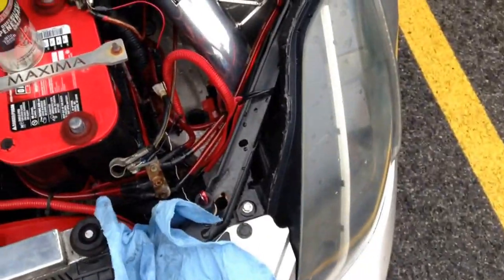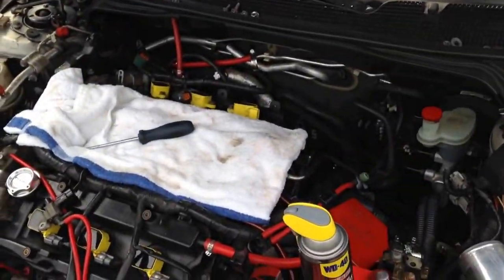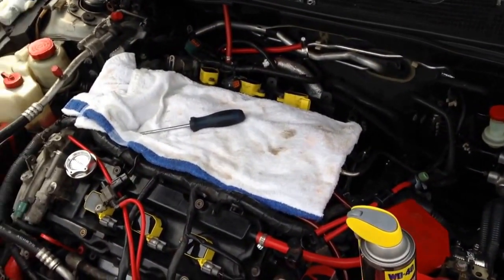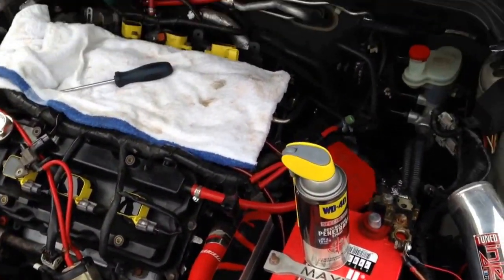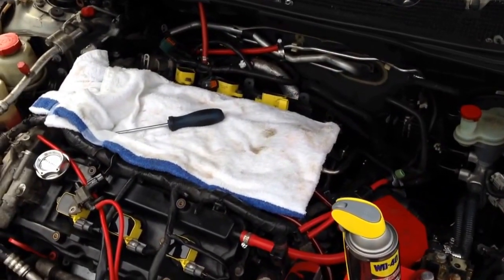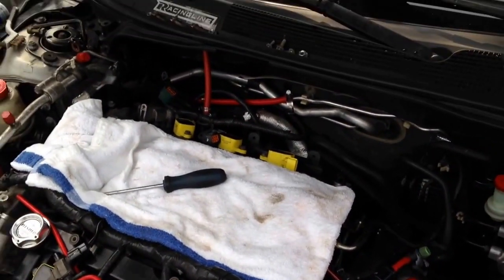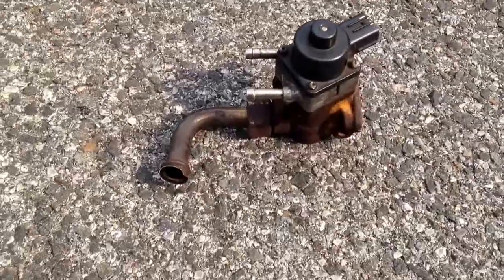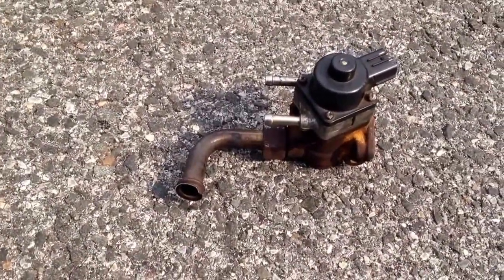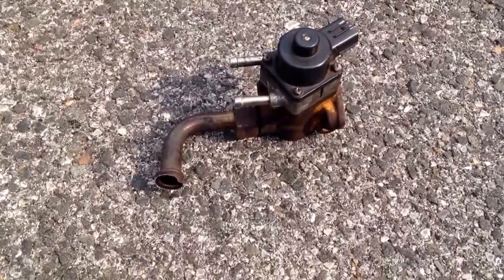Yeah, man. That's what it is. So I did get the EGR valve out, just not the way I wanted to. So now I gotta end up taking the whole pipe out and changing that. Like I said, I'll change the EGR valve, and my other pipe that connects to the inlet on the EGR valve and the outlet on the intake manifold, I got that on deck. That's clean, ready to go. Just waiting for the new EGR valve to come in. And yeah, man, that's the progress. Once that's in, hooked up, and connected, I'll keep you in the loop, team.